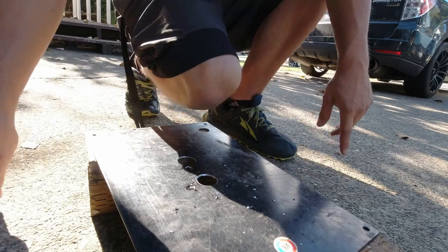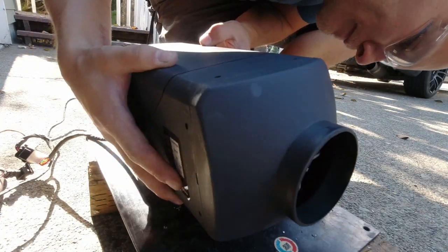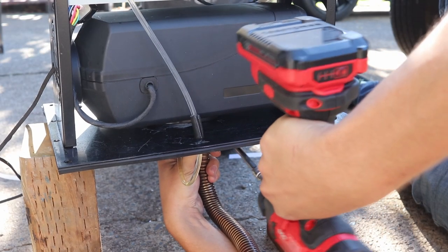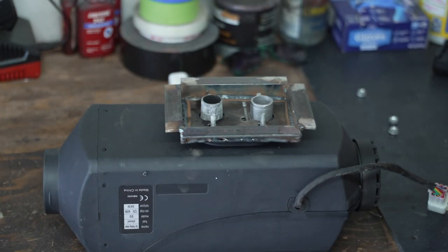I took the lid of my battery box, cut holes in it to match the exhaust ports, and turned the battery box lid into my mounting plate, then reassembled the all-in-one case onto it. I got it put together, working, and sealed up so I could run and use it, and it worked okay. But that was all a big headache that would have been avoided had I just bought the individual component kit. Now that I'm redoing my interior I've moved my heater again, completely discarding the all-in-one case. It's now mounted in the back of the van on a mounting plate that goes directly through the floor — it's sealed, doesn't leak, and it was actually easier to access the exhaust clamps. I wish I had done that from the start.